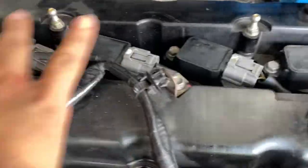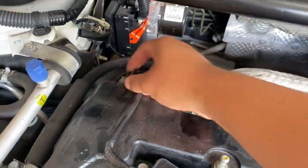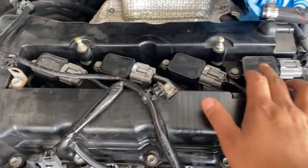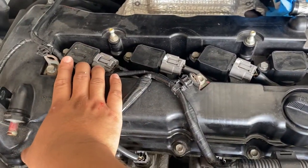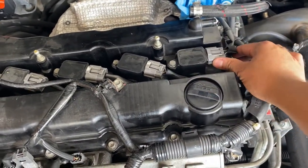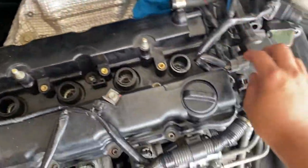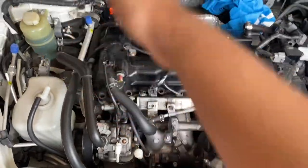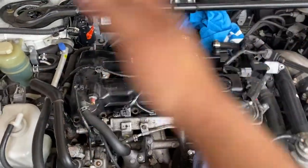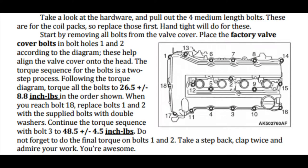Next you have to disconnect these. Oh, I forgot this one too. For these, they have to go back in the same order you took them off. This is the first cylinder, second, third, and fourth — the fourth one is the closest to this side. All of them are off. I'll post how you're supposed to tighten them — they have to be done in a pattern. Once we put it back with the color, I'll post it on screen so you can screenshot it.